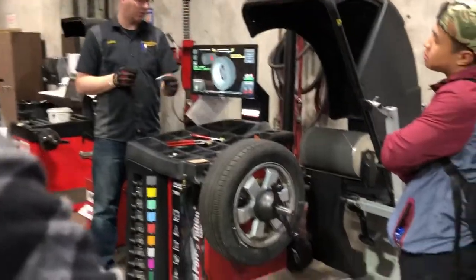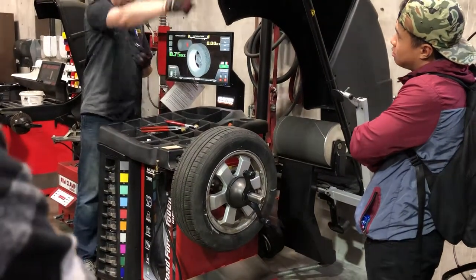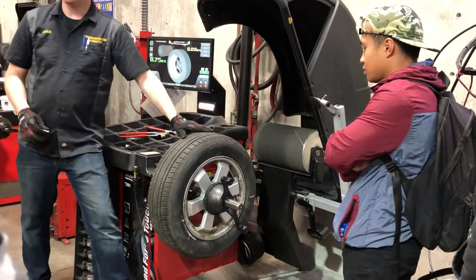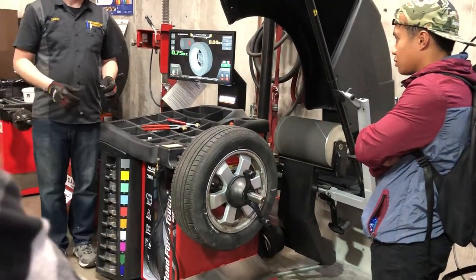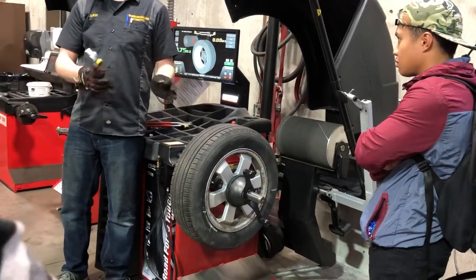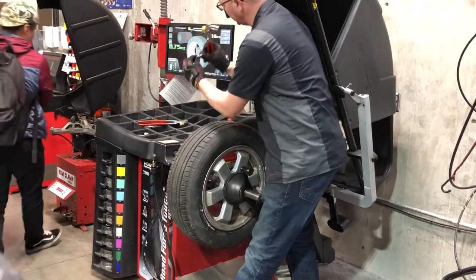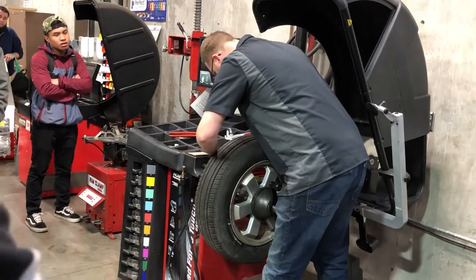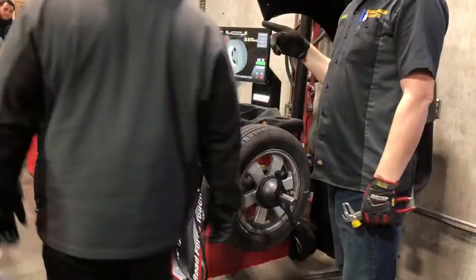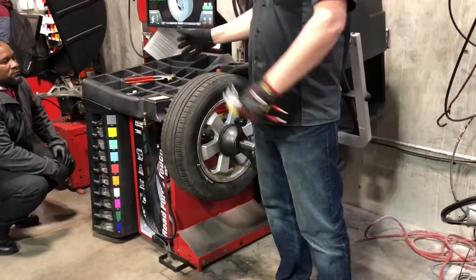I click here and it tries to find that spot — clicking lines it up. My laser light on the inside of the rim lands exactly where I need to put the weight. This is my brake so it won't spin on me while I work. I've found it's easier to lean over the tire when putting a wheel weight on — body mechanics say no if you try from the wrong angle. So I come over here, hit the brake, line it up so the laser goes right through the middle, and drive my weight on.